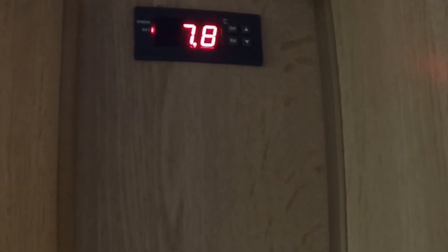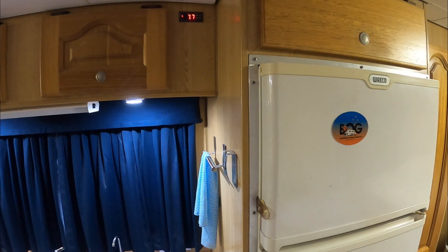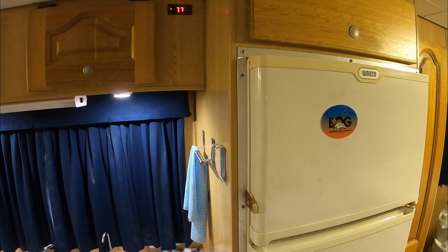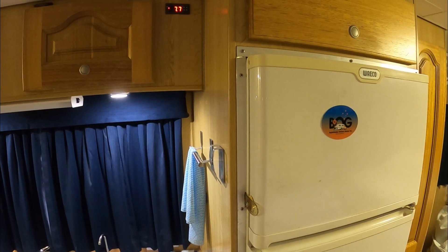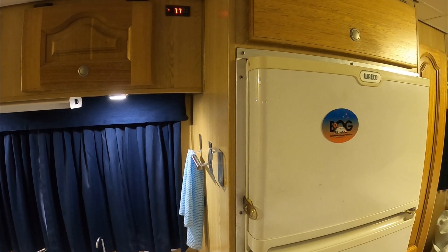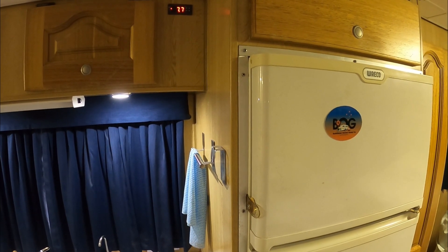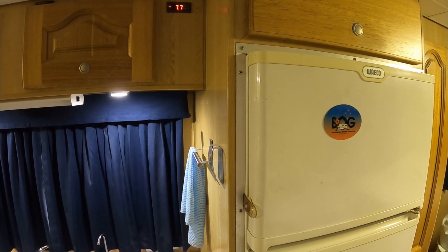I've got lithiums but I still like to limit how long the fridge is running. The electronic controller also has a delay function that you can set — I've got mine set to five minutes, so if the compressor cycles off it won't start again until the five minutes has timed out, even if you've had the door open. I find that setting results in less ice build-up on the back wall so you don't have to defrost it quite so often.